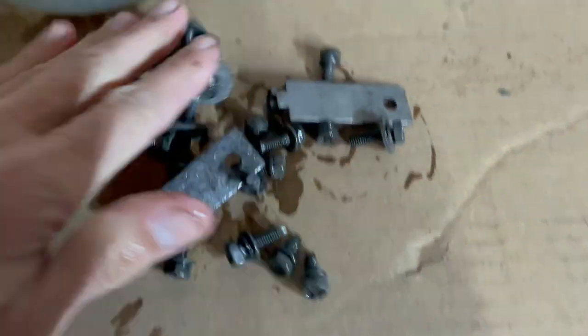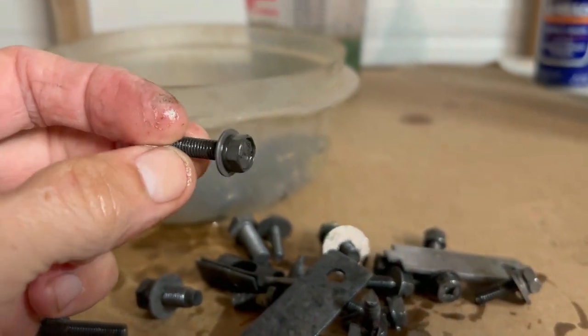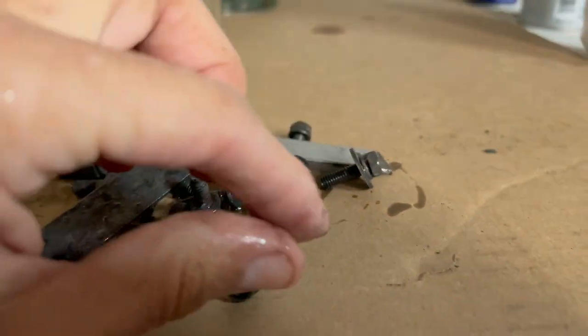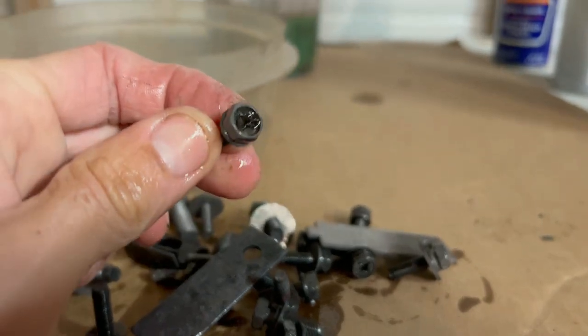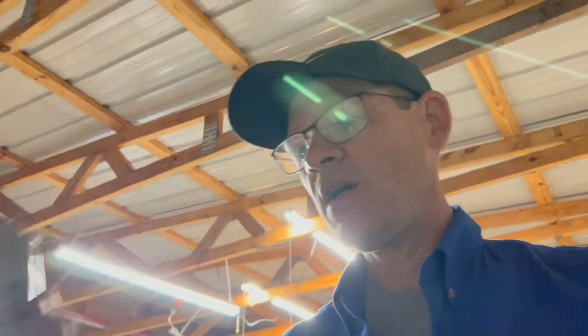This is two batches I've already done — let's take a look at these. Look at the difference of how brand new they look. This is what they come out looking like. You might be wondering what all this wetness is — this is actually WD-40. So when they come out of the acid, you need to clean them with some basic brake cleaner, and then you need to put an alkaline on it, which WD-40 is. It's like the opposite of acid, so you soak it in that.